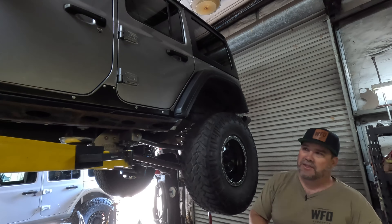You can even see the body mounts bent back — rocks getting all the way up in there. One thing you have to realize is your risk-reward. With full belly skid plates, only running 37s, it's low to the ground and easy to maneuver — handles and drives amazingly. He spent money where it counted: the long arm kit, King two and a half inch remote reservoir shocks with clickers, good wheels with beadlocks, and kept it simple. Sitting on the ground with stock fenders and just bumpers and sliders, it doesn't look that custom — then you look underneath and see what he's doing with it.